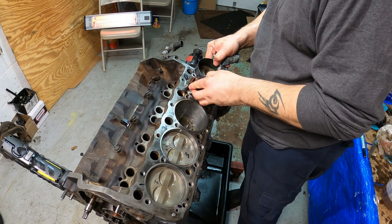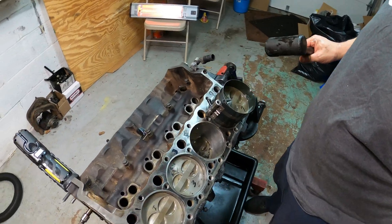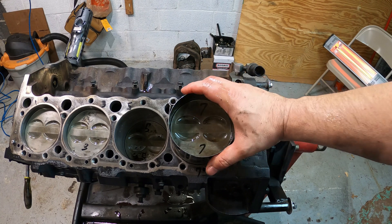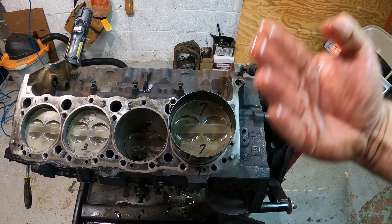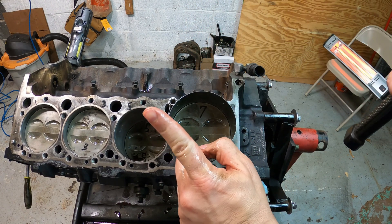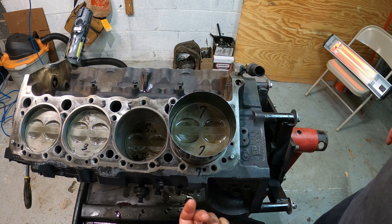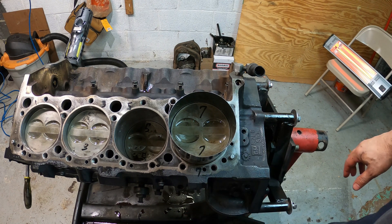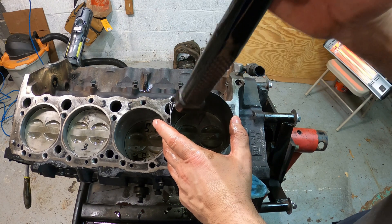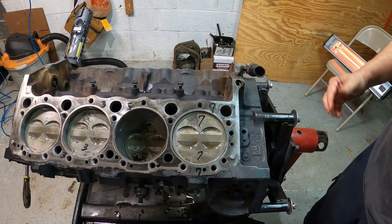Very simple — leave a little bit of the piston skirt out, get a little closer, line up the piston. These are easy to line up because they have the valve reliefs. You want them straight because the connecting rod has to go down out to the crankshaft. Gently tap. Quick note: make sure the crank journal is straight down so you don't smack the connecting rod bolt to the crank journal — you'll have all sorts of problems if you nick the crank. She's in. Piston is in.